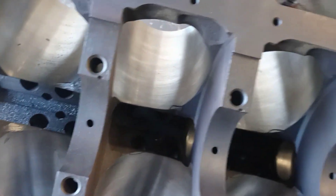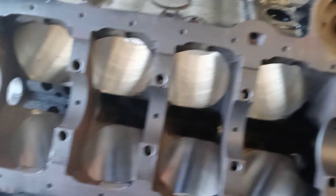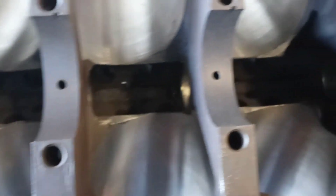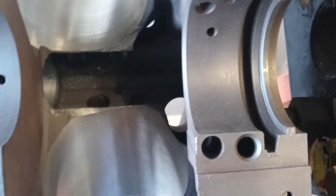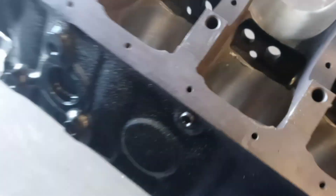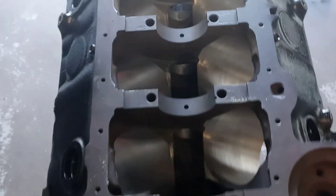I'm going to go ahead and finish up these other cylinders. I'm going to blow all these shavings out, clean the block, mark it back up with the pistons in, and rotate it again. All right, so this is what we look like with all the cylinders done. You can pretty much see exactly where I had removed the material — we got a lot of little shavings in there. We're going to wash the block, blow all this out, wash it one more time, make sure we get all the shavings out, then mark it up again to make sure everything is clear before we start the final assembly.